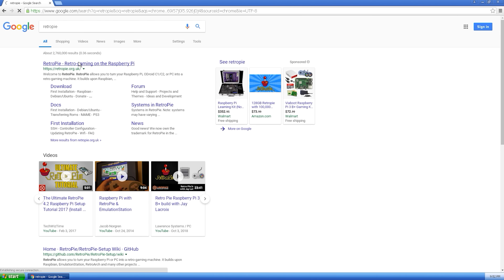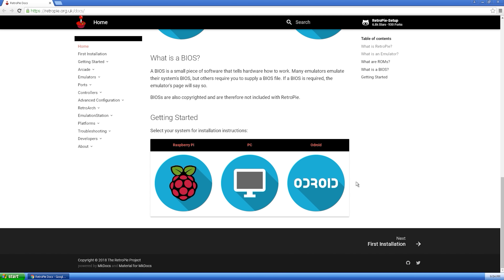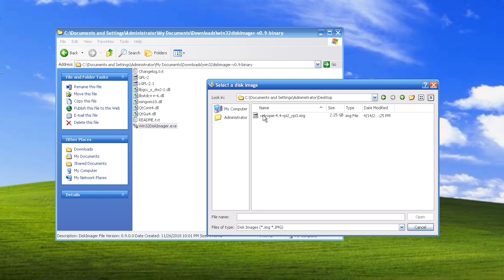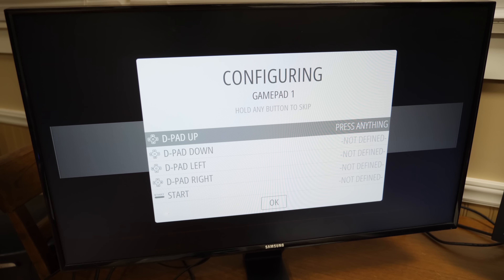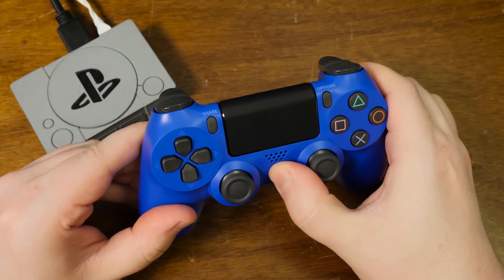There are links to everything in the video description, and to be clear I am not affiliated with any of these sites or services — they just worked out for me. Now for the software side of things, which is thankfully all free. Raspberry Pis don't come with their own OS, but getting one on there is straightforward thanks to the excellent RetroPie project, which combines things like Raspbian, Emulation Station, and RetroArch into one pre-configured package. One of the PlayStation emulators it comes with is PCSX ReArmed — the same emulator Sony chose for the official PlayStation Classic. Download the appropriate pre-made image to your computer, plug in your microSD card, and run either Win32 Disk Imager, ApplePi Baker, or Etcher depending on your OS. This writes the entire RetroPie setup onto the card pretty much ready to go. Once done, insert the card into the Pi, power it on, and expand the file system through the configuration options. The first order of business is setting up an input device — while it defaults to an Xbox controller you can customize it to work with nearly anything using USB or Bluetooth. I went with a PS4 controller since it feels great for PS1 games and can pair via Bluetooth with no problem.